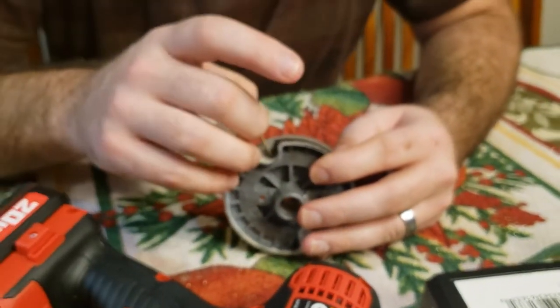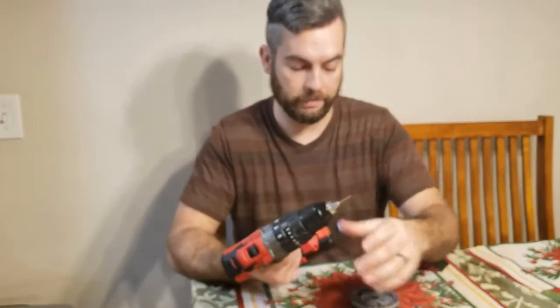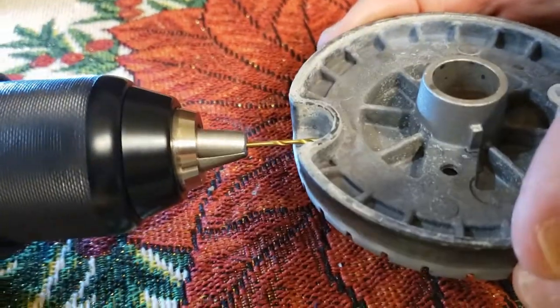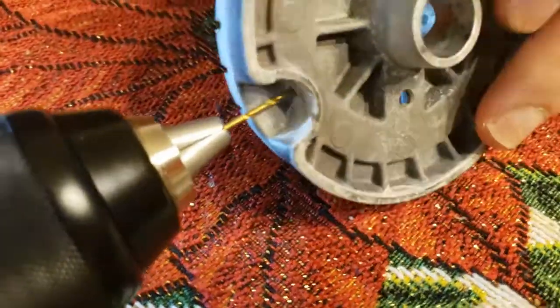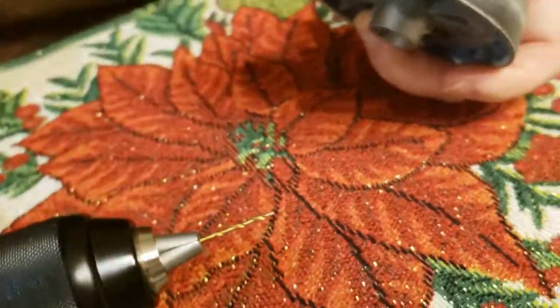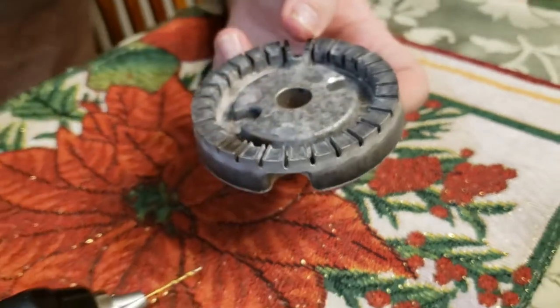So I know that this is the exact size this hole is supposed to be. We're not re-engineering — we're doing a maintenance. We're going to be super careful. We're not making the hole bigger or oblong — we're just going to insert the drill bit here and go at a slow RPM until you feel it starting to go in. And then it popped. If I flip this over, we should be able to see the drill bit through there — and that's your port. Your gas fills up around here and then it wants to come out that hole into your port. Now you can actually see right through it. That should allow gas through. So let's go ahead and set this back on there — it's a super simple fix, but it can cause such an aggravation if you don't know what the problem is.